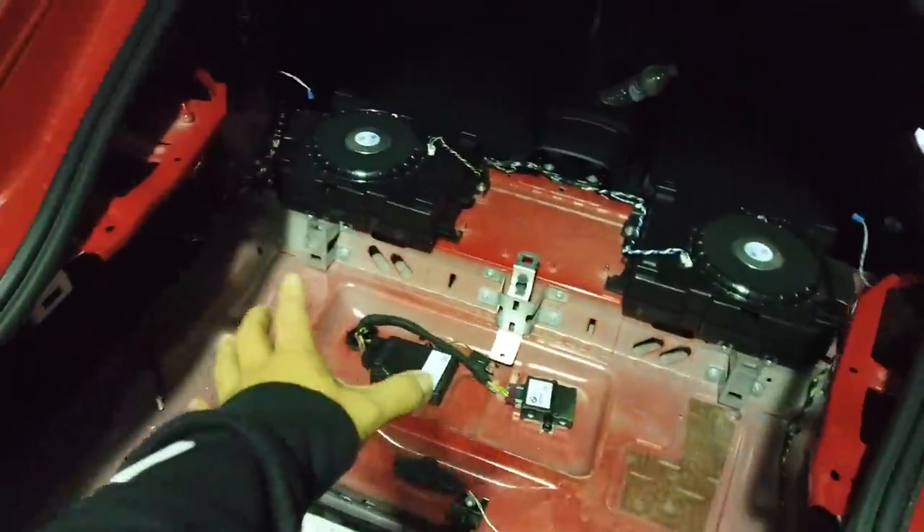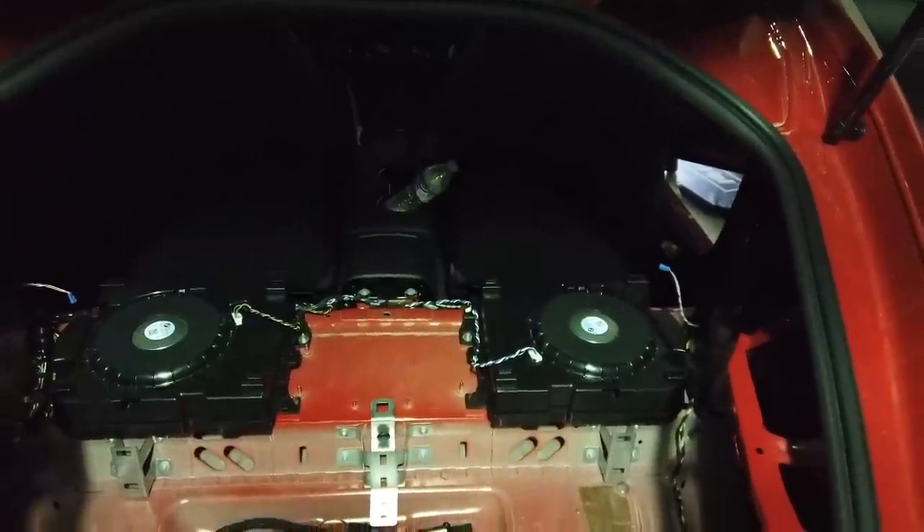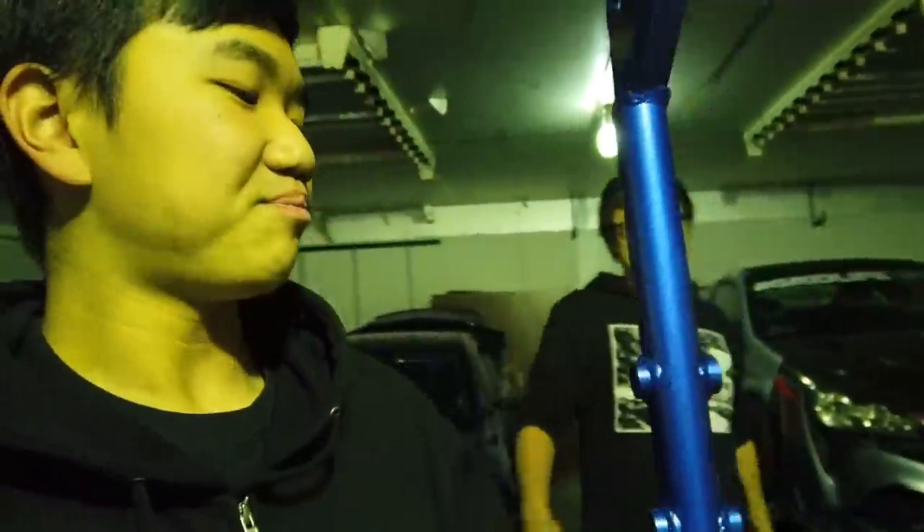I took care of the back in a staggering hour and a half. Everything we need to get out is out. Battery will be next — I still have to do the two subwoofers. Then we can put in this Cusco rear bar. Those who know Cusco in racing will call it 'Crushco,' because they have this reputation for bolt-in cages that aren't particularly safe. It is quality for bolt-in cages, yes, but sometimes when you actually have an accident it does more harm than help. Whether or not I install this is a bit of a head scratcher. I bought it because I really needed the ECU space — it can help me mount the harnesses, but we actually have a slightly better solution coming. I'm going to throw these in just for testing so I can actually use the harnesses, but before the actual event I think we'll have something better.